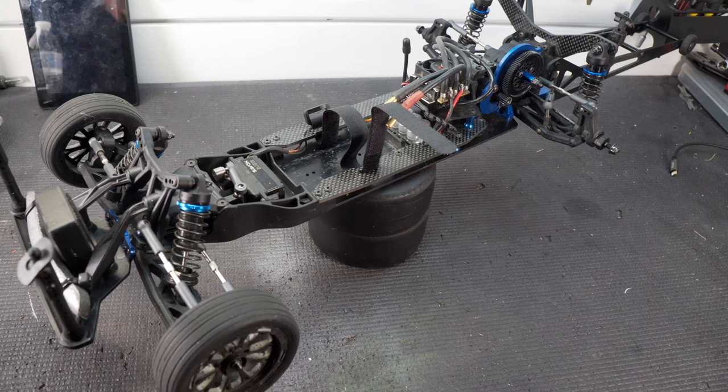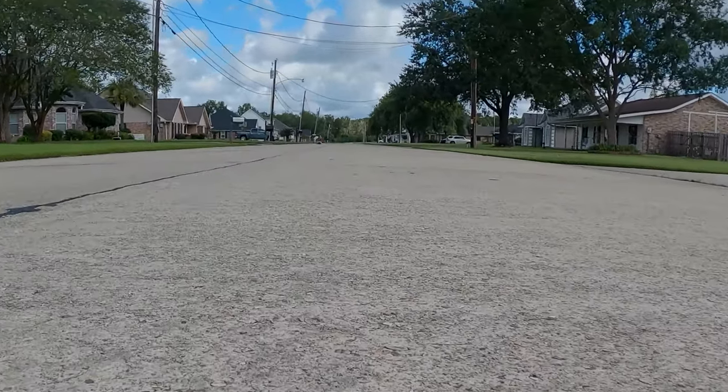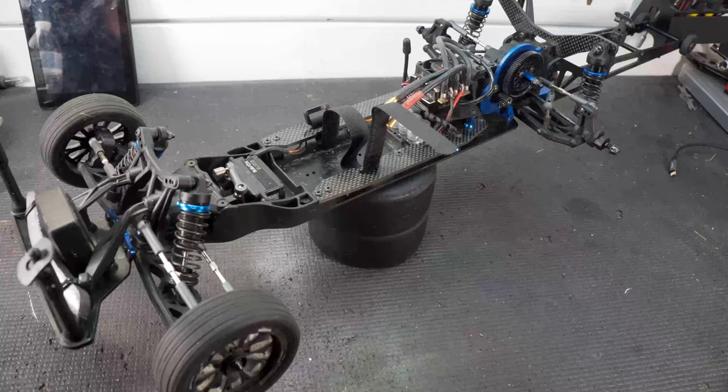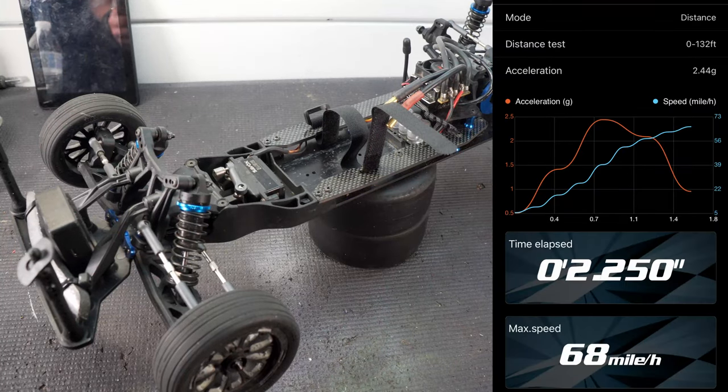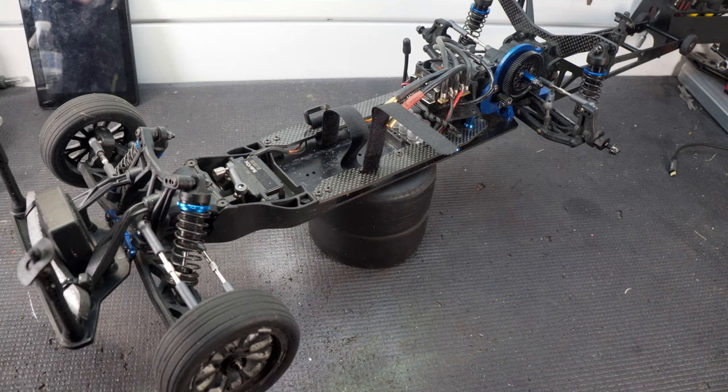From there I left the Pro-Line split six beadlocks on and continued running with those for the rest of the day. I started playing around with some tuning. On the next pass, the only thing I touched was putting a little more turbo in at the end of the pass and bumping my initial stage up to 50%. That got us to a 2.25 at 68mph - I slowed down a little ET-wise but gained a couple miles per hour, and I saw my G-forces jump up with more consistent power throughout the run.